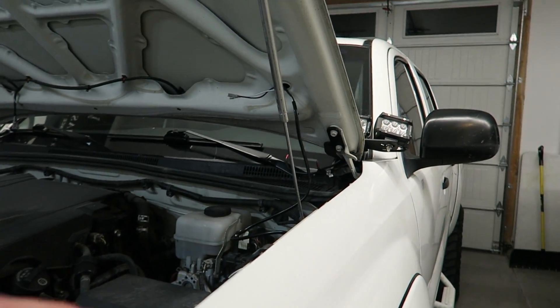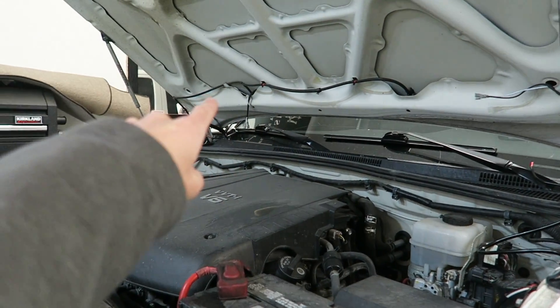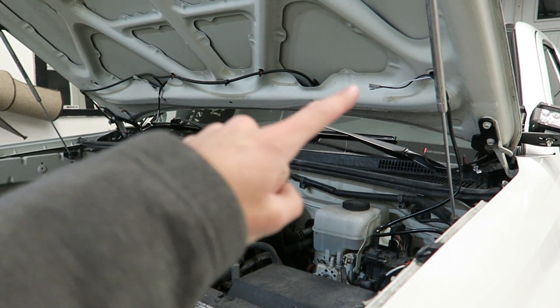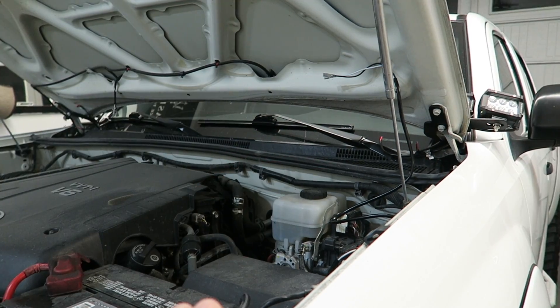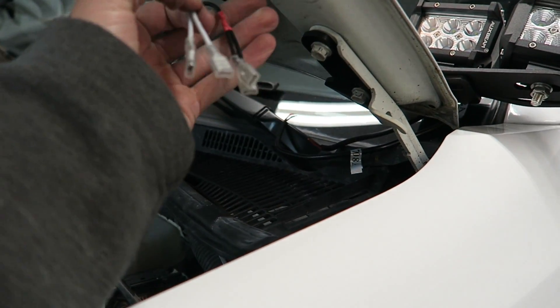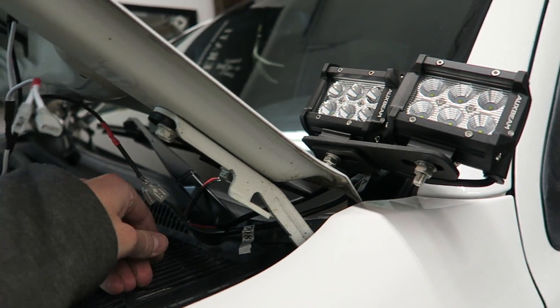Okay, let's get to the wire. The wiring harness goes up to here and has a connection there, then it goes over to the other side but falls just short. What I'm going to do is take an extra wiring harness, solder it on, and add a connection so that both pods are on the same wiring harness — that way one switch will light up all four pods. After soldering, we have two positives and two negatives running to the positive and negative of each one of the ditch lights, and the same thing on the other side.